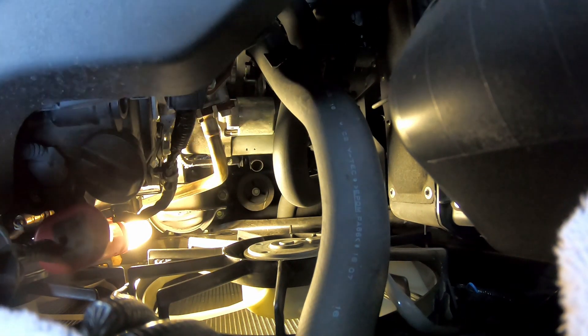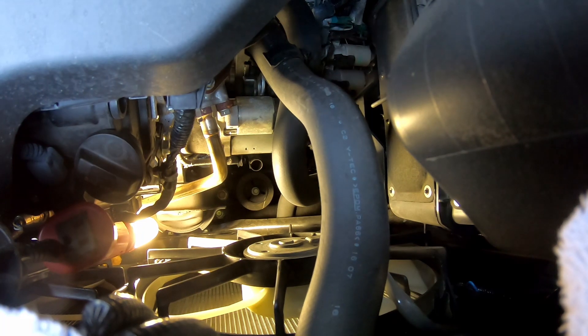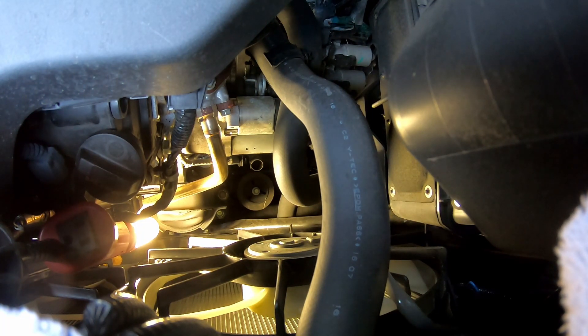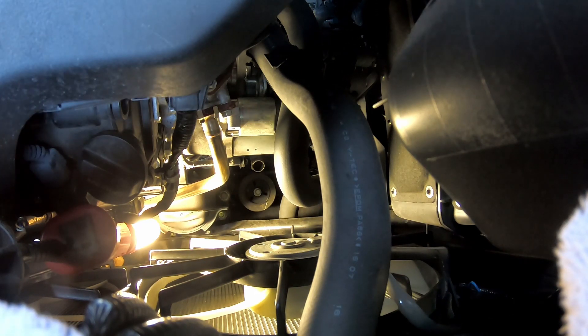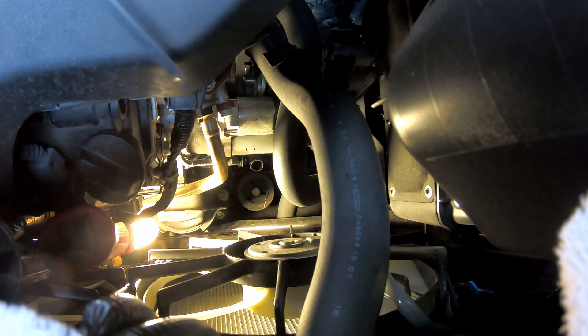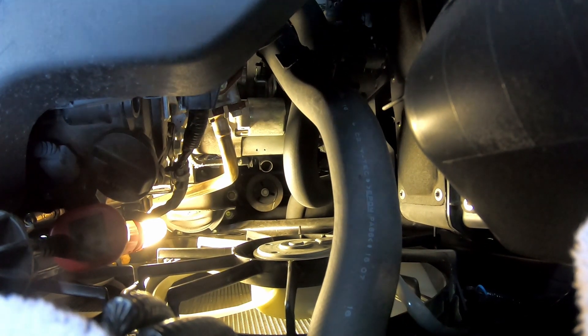Here it is — it's just a short little bugger. So maybe you guys that are more well-versed in Honda Ridgeline transmissions can tell me — I believe this is not a standard conventional automatic transmission, and I don't think it's a DCT either, but what do I know. I don't know if this is to be done in park or if you can check at any time with the engine off. I'm going to put the 3.3 quarts back in and see where that lands us on the dipstick, then adjust as necessary.